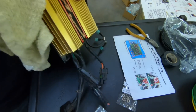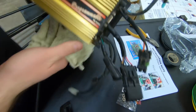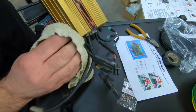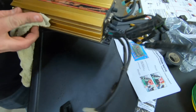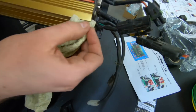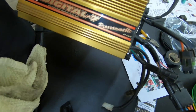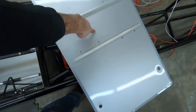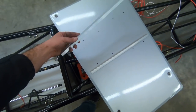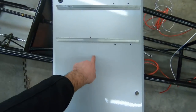Before you get all over me about this Digital 7 ignition box being outlawed in NHRA competition — this is the 7530T, so pay attention to that part number. I can't tell you off the top of my head which part numbers are allowed and which ones are not in NHRA competition, but I have done my research and I know this one is okay. There are some Digital 7 programmable ignition boxes that are outlawed — I think it's the 7530 without the T, but do your own research. Also, this panel is a little floppy, so I cut out a couple small chunks of aluminum that I'm going to rivet to the bottom side between the main component mounts to stiffen it up.